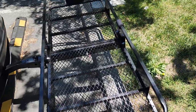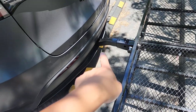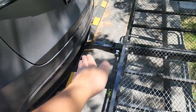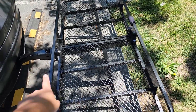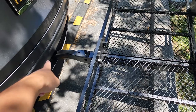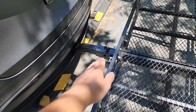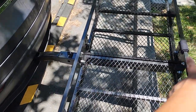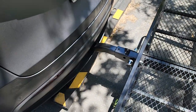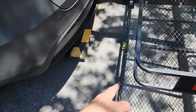These kinds of trailers work well. The only thing to keep in mind is the weight limit — 160 pounds of downward force. The further out this extends, the more leverage it has, so heavier stuff out here makes it a lot harder on the hitch. Keep that in mind: if you're putting heavier stuff on it, you probably want it closer to the car, not as far back as possible. Racks that sit as close to the car as possible are probably better.